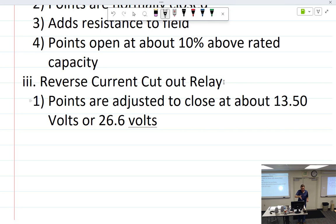Now, when the battery voltage is higher, what does that mean? Well, what if the battery is just dead? It's bricked and it's only got like 2 volts. Well, then your generator will work all the way down to then, because there's nothing to go backwards. So if your battery is pretty dead, at 6 volts, and you pull the power back on the generator, and it goes 13, 10, 8, it's still going to work. So it basically only senses the difference. It's got to go backwards. So once it goes below 6, then it would reverse because of the dead battery. So that would be fun because you see everything really dim.